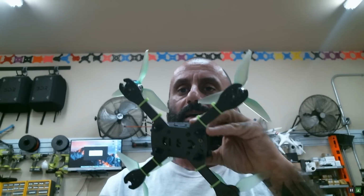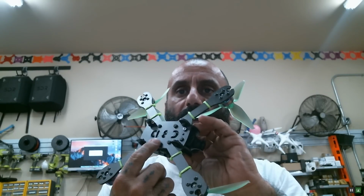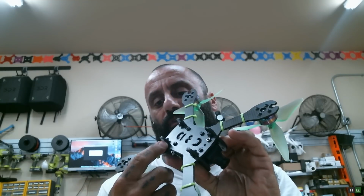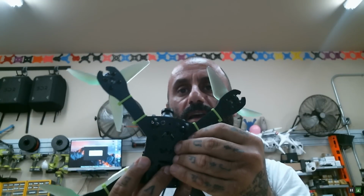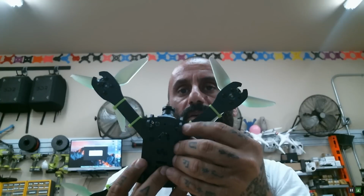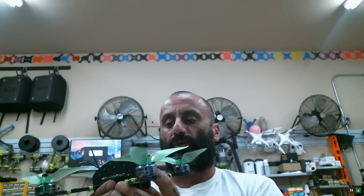What I do, and what I feel is unique to my design, is I use slotted design technology. So basically I figure out how I want my carbon fiber to sit, and then I start cutting slots in it, and then I slide pieces inside another piece, and then I fasten it. Here you can see that there is a screw on this side and the nut on this side. There was a spacer here at one point, but I wanted to eliminate some weight, so I took that out.